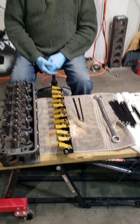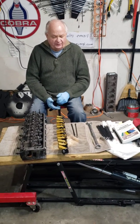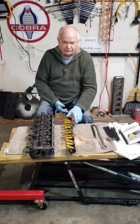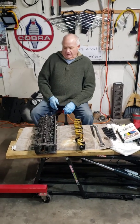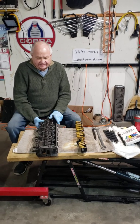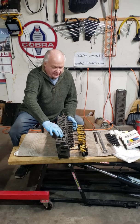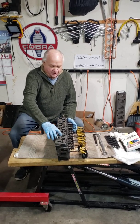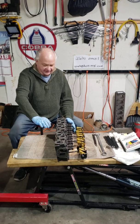Find someone who will do the porting and the preparation for your cylinder head, and hopefully they're not learning for the first time with the Triumph head on you. Also, the surface where the intake and the exhaust manifold goes should be skimmed by your machine shop — it needs to be perfectly flat.